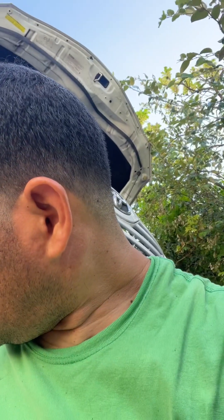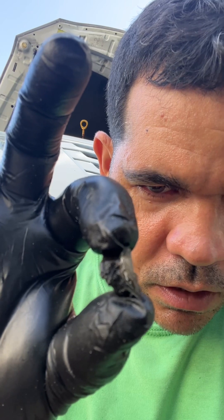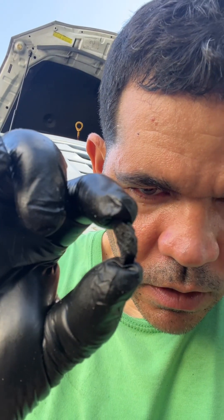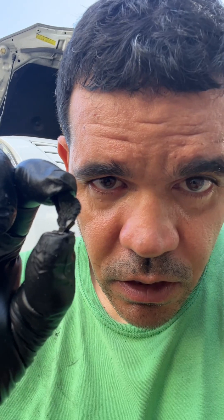While I was cleaning the mating surfaces, I discovered that the oil pickup tube had a lot of blockage — there were actual chunks of metal pieces in there. Let me show you what it looked like. There was a lot of metal debris inside the pickup tube. This was likely the problem causing the oil pressure warning light to come on because it was losing pressure. I'm not sure where the metal came from but I hope the engine isn't worn out.